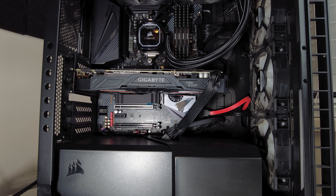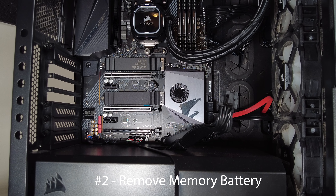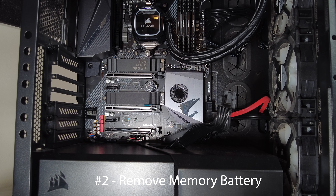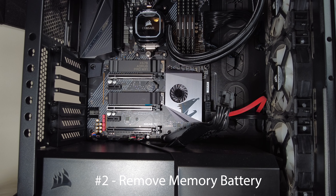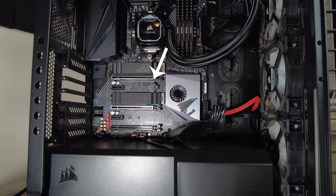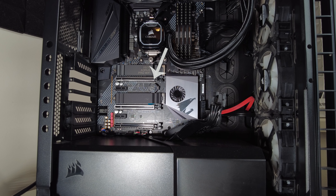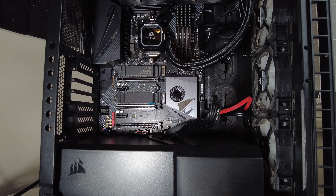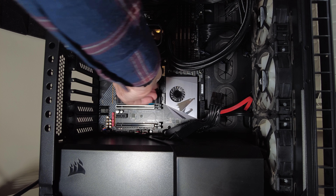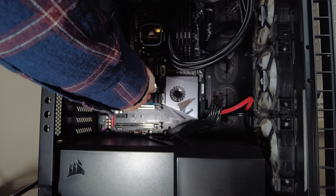I don't have one on my motherboard, so I have to either rely on the battery or actually shorting the CMOS switch. Let's start with the battery option, since shorting something doesn't sound all that appealing if you don't have a lot of computer experience. All you need to do is locate the little round battery on your motherboard — you can confirm the location in your instructions. Take it out, wait five minutes, and then replace it. That should bring you back to square one and restore your screen, but it's not always the case, so there is another option.